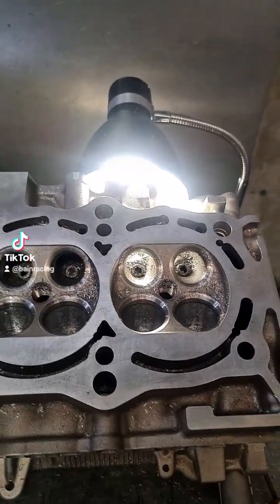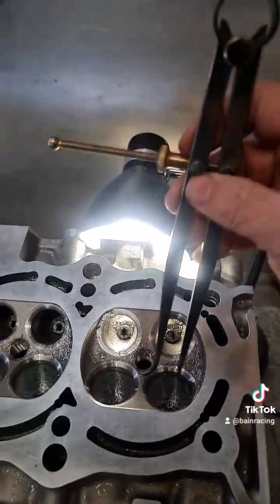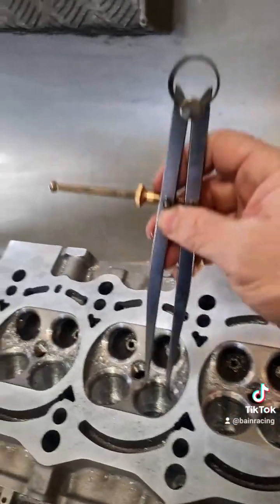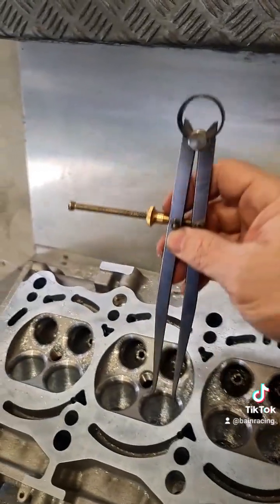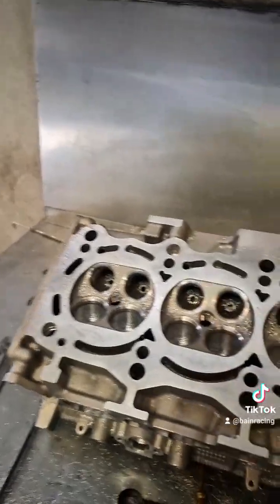So I'll turn the camera around and show you where we're at. We're going to rough out the exhaust seats. I've done the intakes and they're not too bad. Don't get too fussed with sizes — just get them ball-parked, rough it out. These are all probably within ten-thousandths — actually pretty close.